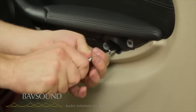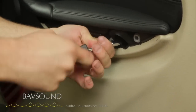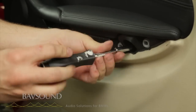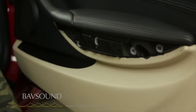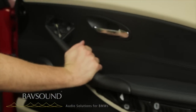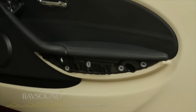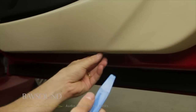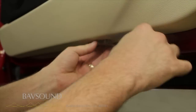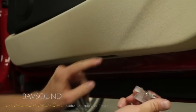And they put them in there, so when you put it back together, be conscientious of it. With those guys out, we now have all five screws out of the door. Last little thing before we take the door itself off: there's a little light down here. We're going to take our plastic panel removal tool, pry it under the light, depress this little tab, pop it right out, and unplug the light.